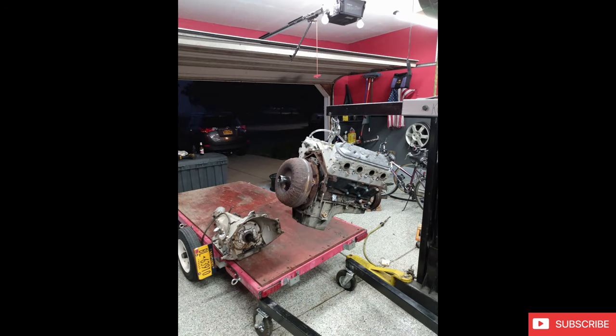And you can see here that I've got the tranny off of the engine, kind of hung from the cherry picker there, just generally inspecting the condition. So the idea is get yourself an engine with known history. Try to get an entire running dropout if you can. If it comes out of a running and driving vehicle, you're just that much further ahead. You at least know that this thing moves and doesn't have any sort of rod knock, lifter knock, valve train noise, transmission issues, what have you. Anything along those lines. Always a good idea to just have some history on it.